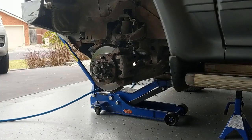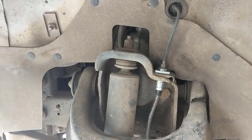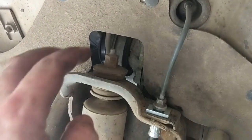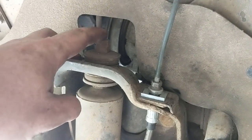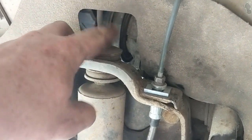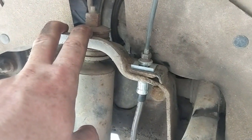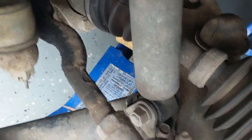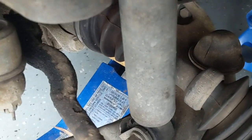Get the wheel out of the way. So, this is an easy job. All we have to do is remove these nuts here. The way you do that is you hit them with a bit of penetrating oil and wait for it to sink in. Then grab the top bit with a pair of vice grips so the shock can't turn, and loosen the nuts. The Haynes manual says to remove the nuts on either side at the bottom, but they're really hard to get to, and that's dumb.